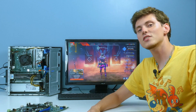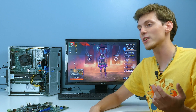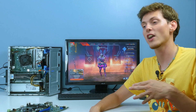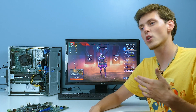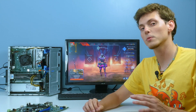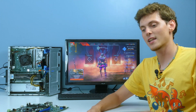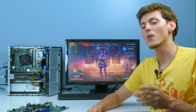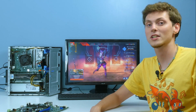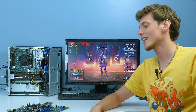That wraps up today's video on the Dell Optiplex 3040 sleeper gaming PC. I went with the RX 470 due to the power limitations — it pulls 110 watts at full load, and the i5-6500 pulls 65 watts. Adding the hard drive, motherboard chipset, and ethernet card, we're sitting at about 200 to 210 watts, which is the safety zone for that power supply. I can't believe the solution of using SATA power cables adapted to an 8-pin PCIe cable actually worked, since the power supply has no PCIe cables at all. I had to get creative and I'm really surprised it worked out. Would I recommend doing that in a normal computer? No — but when you have no other choice, you might as well try.